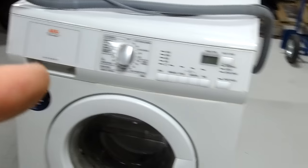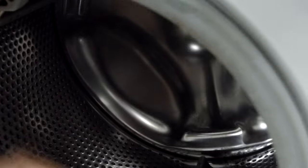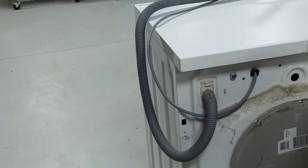So we got it in and it's an AEG — it's not that old, it should be a good make. But when it goes on spinning it makes a real racket — the bearings are gone. I've looked at a video on YouTube, and when the drum is doing that, you've got a problem. It'll sort of turn, it's not that noisy, but something's gone and I'm going to have to replace the seal. I hate spending money on things, I hate throwing things away as well. We're not trained washing machine repairers, are we Ian? We're not trained in anything actually.